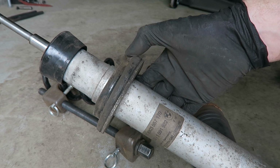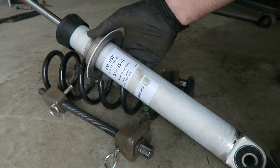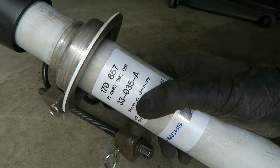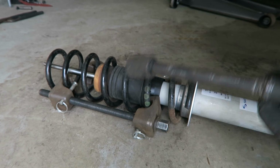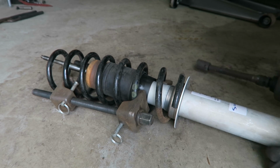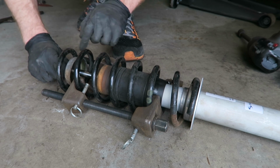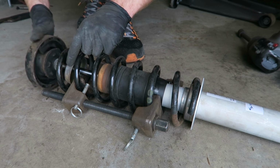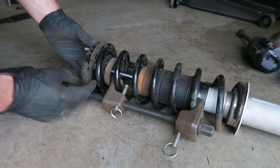Now you can also reuse this bottom spring pad here, transfer it over to the new strut, but I'm not going to be reusing these. Here's our new strut. Once again, link for these in the description below. Made in Germany, that's what we like to see. And again, just be sure that the coil here sets down into the top of the spring hat.